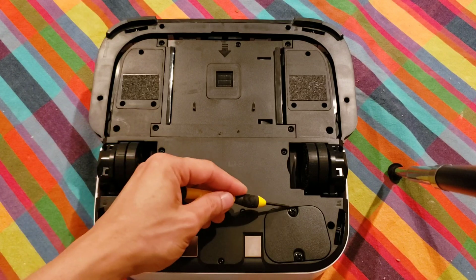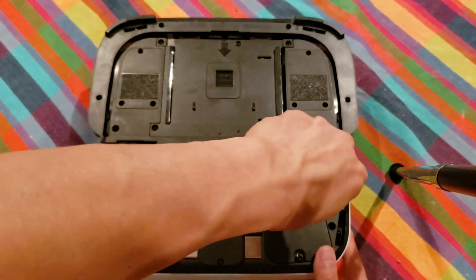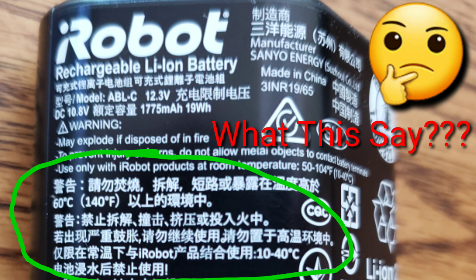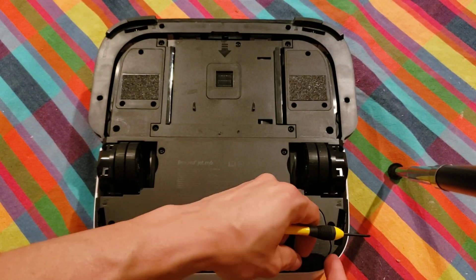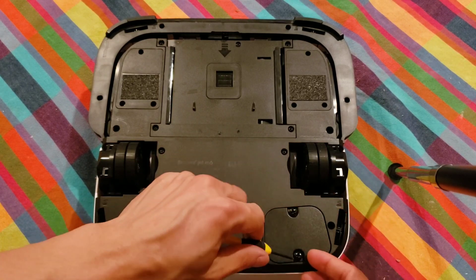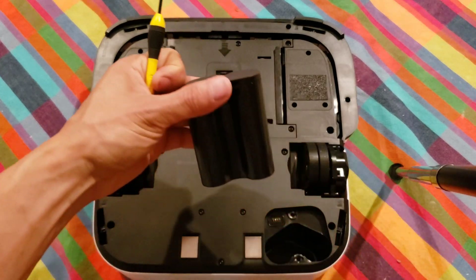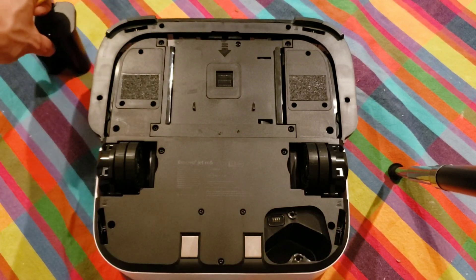With any teardown, it's good to disconnect the power just in case there's any high voltages. I know this is a low voltage application but it doesn't hurt to remove the battery. The nameplate on this battery is 1775mAh at 19Wh. This is a typical lithium-ion battery. The benefit of lithium-ion batteries is they're smaller and lightweight and have a higher discharge rate than a standard nickel-cadmium or dry cell battery, so these batteries look really small but they can run these products for hours on end.